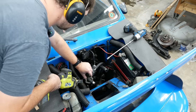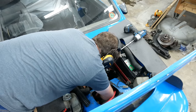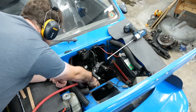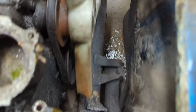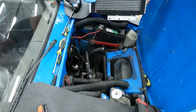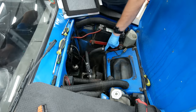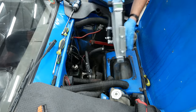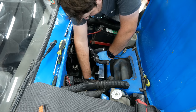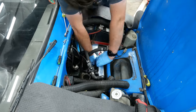Is this too big? Will the angle grinder fit? Will the air saw fit in here? I got one. I got the other one — down there are where some brackets used to be. I put a foam seal on the back of the radiator to hopefully seal against the wall, and I've already attached the lower radiator hose because I had to cut it and there's no access once it's in place. I've pre-drilled the holes in the fiberglass — I had to go buy a right-angle drill to do so. Just drop it in there and screw it in place. Yes, I am screwing straight into the fiberglass. Annoyingly, I cannot see what I'm doing at all. We can just fast-forward through this struggling — that stripped it straight out. That didn't work at all.